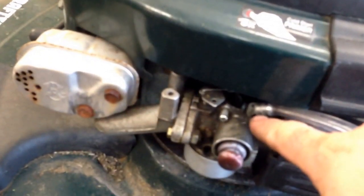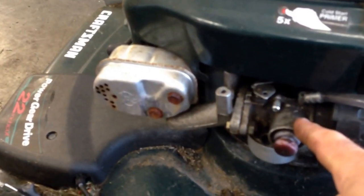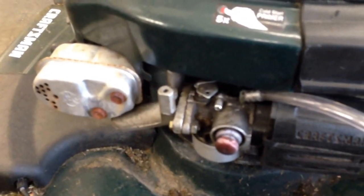This is the vent on the top of the carburetor — it plugs into the crankcase. It's got California emissions so it was just sucking a little vapor off the crankcase. I plugged in there because it's super easy and convenient. You could drill a hole in the end of the air cleaner and shove this hose through until it's inside the carburetor, as long as it doesn't get in the way of the throttle plate. It's just quarter-inch vinyl hose — you can use 3/8 inch or whatever, it doesn't really matter. Then there's a regular fuel line for the carb.